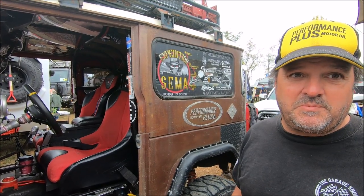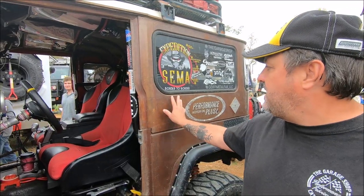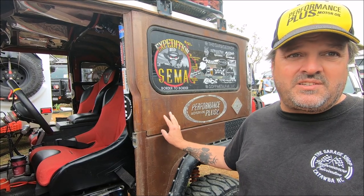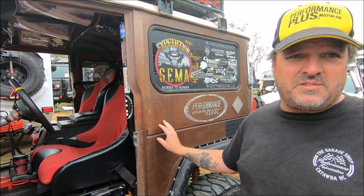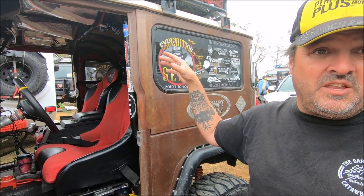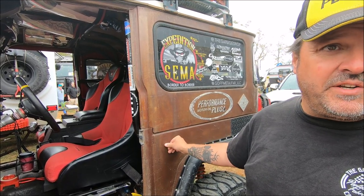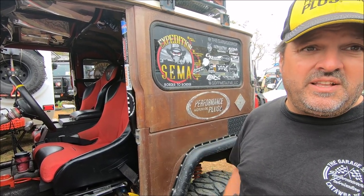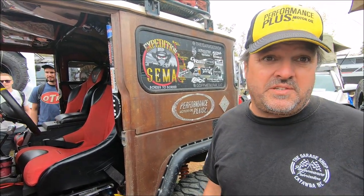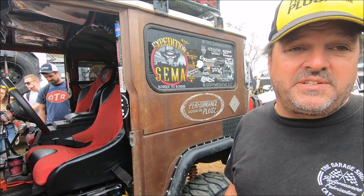I have a '39 Ford land speed truck, a 200 mile-an-hour truck that we run, and I wanted them to match. So what we did is we blast the body, wipe it all down with vinegar, use hydrogen peroxide, salt, sea salt, and a water solution and gently spray it on there. Then we use a shower head we built to simulate rain — it gives it the natural grain finish. We let it sit for about a month, then scotch-bright it with grey Scotch-Brite, real gentle, with water. Once we get the finish we like, we mat clear it and call it a day.